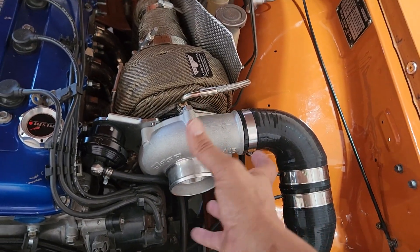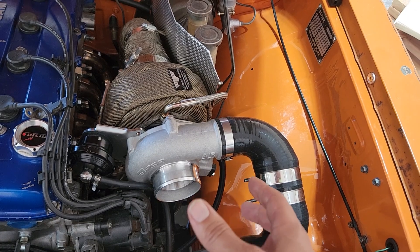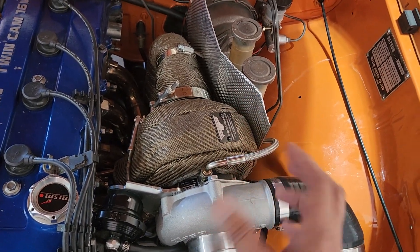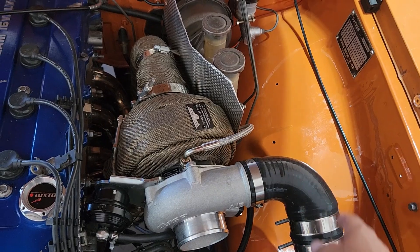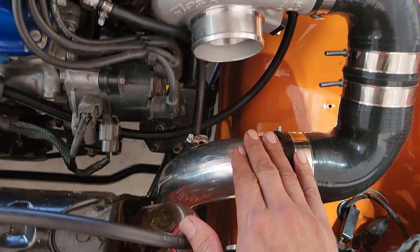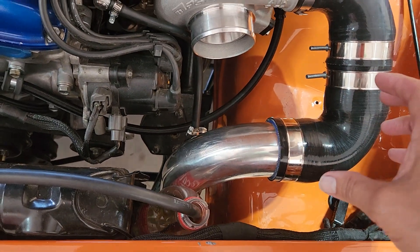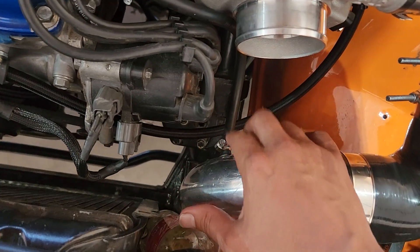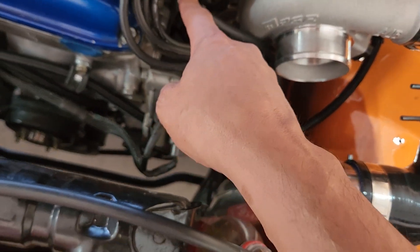As far as the plumbing goes, we'll start with the intercooler. I had to custom clock this — these internally wastegated turbos, you can't just clock them like a non-internally wastegated turbo. The brackets on the back are different lengths, so I had to make new brackets. I took the old ones off and clocked it where I wanted so the wastegate isn't hitting anything and the outlet is pointing the right way. The intercooler comes off with two 90s, a piece of aluminum pipe, and two 90s to a pipe from a CX Racing kit for a 240SX that I had to cut up. This pipe had a compound bend — kind of a 90 and then another 90 — so I was able to make it fit. I had a little bung welded in for a boost line or wastegate line that runs from there to the wastegate and actuates it well.